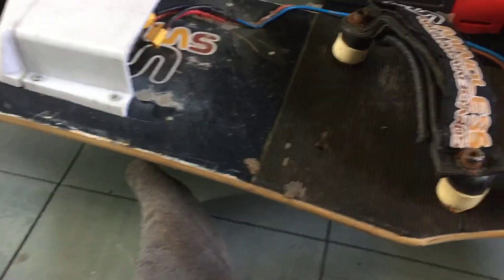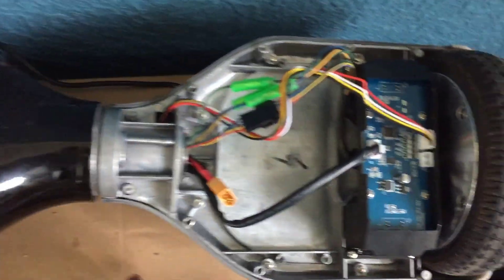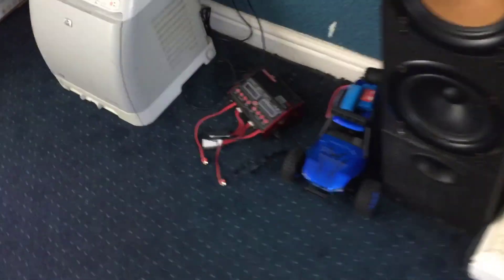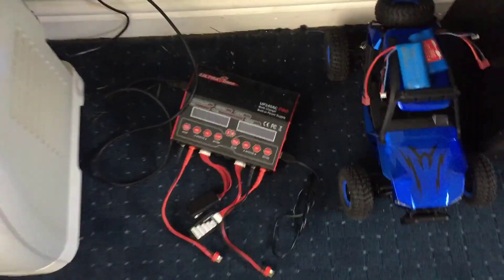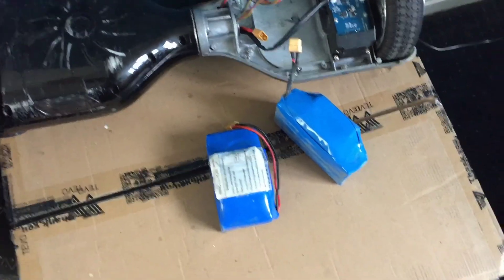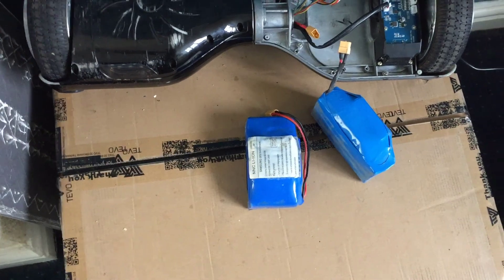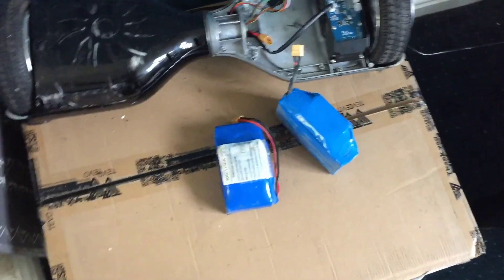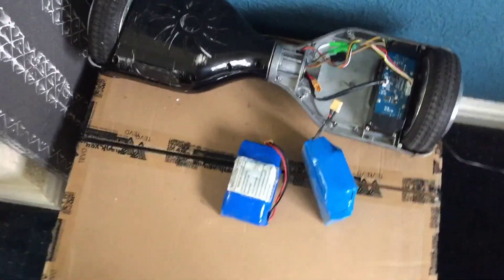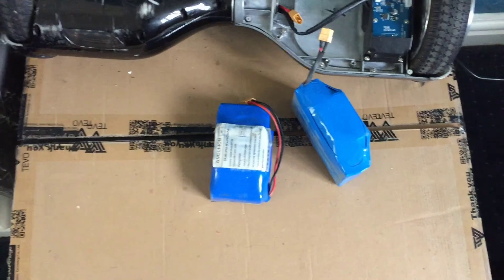Overall it's quite a good skateboard. If you're wondering how I'm charging this — I take both batteries out of the skateboard and plug each one back into the hoverboard and charge it via the hoverboard. That's the safest option I've got at the minute. I do have a balance charger but it doesn't go up to 10S, which is the voltage I need, so unfortunately I have to charge each battery individually. It's about 1 amp hour, which is probably not sufficient — I probably need about 11 amp hours for the longevity I want. On the other board it lasted about three days; on this board, going through long grass and heavy use, it lasted a couple of hours. But nowhere near enough power — I'm using 1 amp and I want about 11.